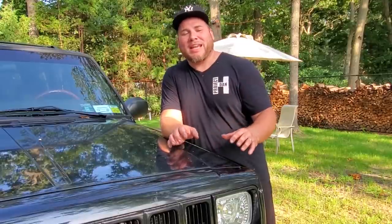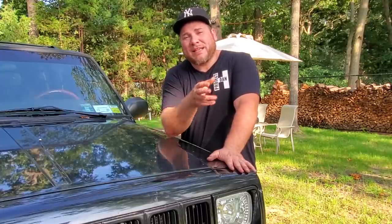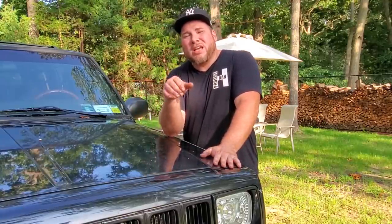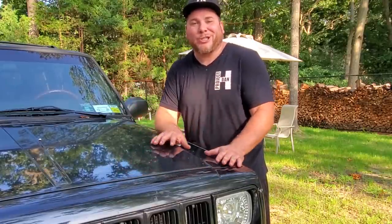That is a wrap for our comprehensive parts preparation video for everything you need to get ZJ rear disc brake parts prepared for an XJ. I'll leave a link in the description to all the parts I used so you can use them for your own build. This works for a Dana 35 or a Chrysler 8 and a quarter — you'll just need to widen the hole on the backing plate for the larger diameter Chrysler 8.25. This is good for all XJs. We're coming up on 10,000 subscribers — thank you so much! Mash that like button, subscribe, share it with your friends, and I'll see you guys on the next project.